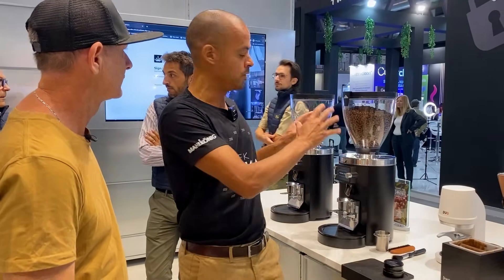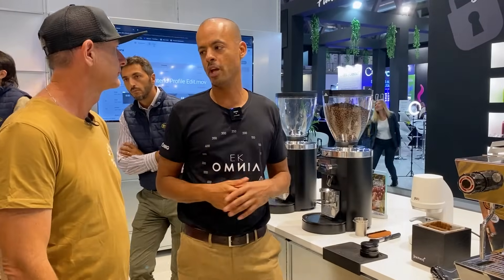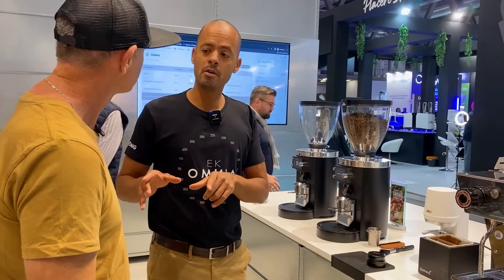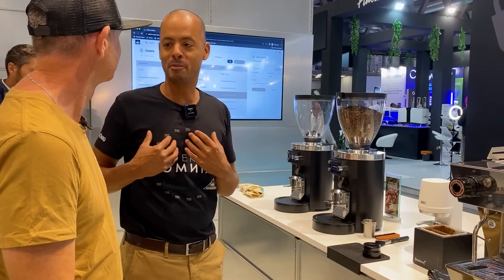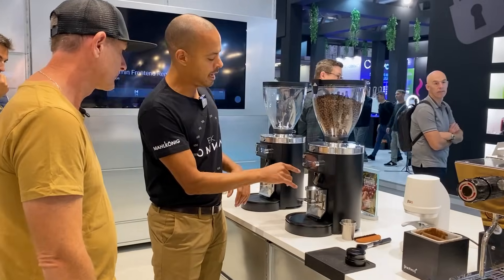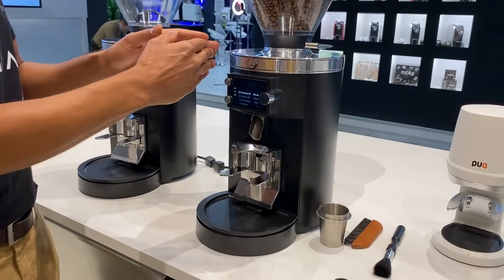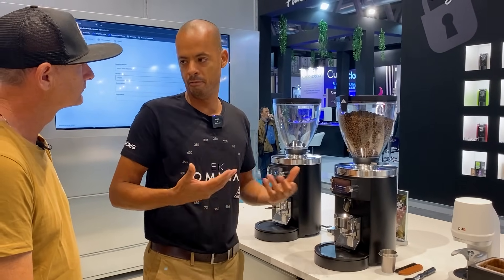You can roll out recipes onto the grinder and across a number of grinders, and even push software updates — that's great for consistency from a roaster's perspective, making sure a recipe is working across all equipment. Importantly, you do not need to use the sync feature — if you're not comfortable with it, you can still use the grinder as a standalone by simply going into the recipe and choosing a custom disc distance, similar to the lever version. But now it's motorised, which is very direct with no gearing mechanism on the burr — that offers an extra level of precision in your control.